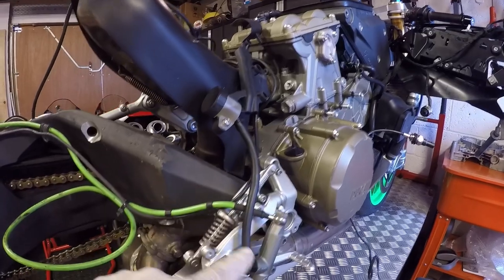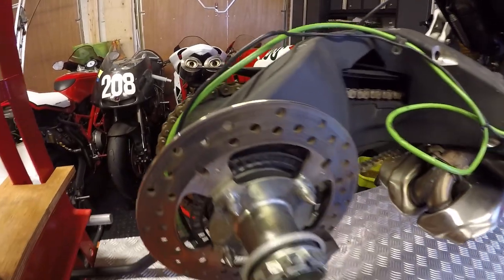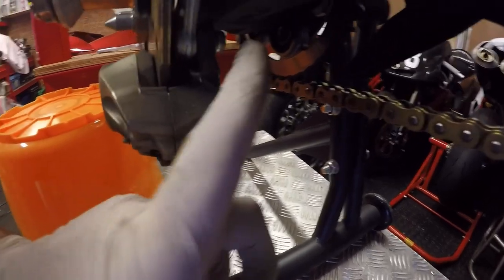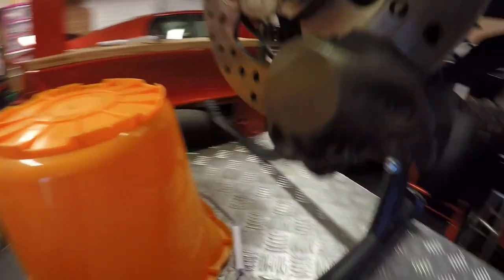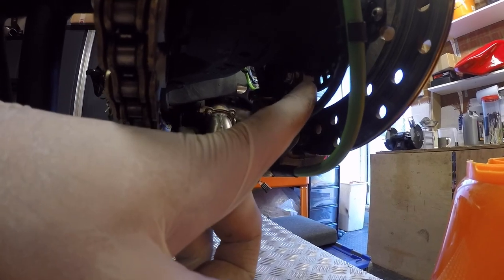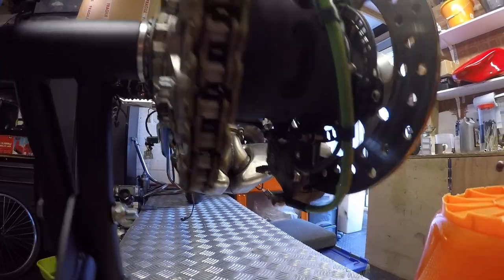Reservoir and master cylinder lines — all three done. All I've got to do now is take off the rear caliper, which is two bolts, and also the ABS sensor. Now there are some shims behind here so make sure that you don't lose those when they come off. Let's get the caliper and the ABS sensor taken off.